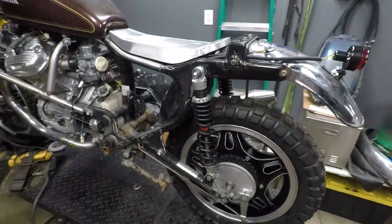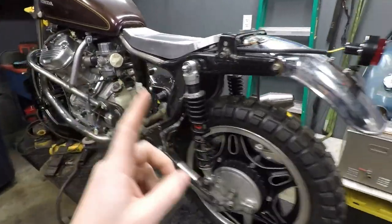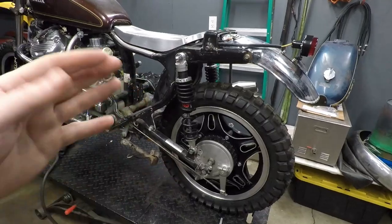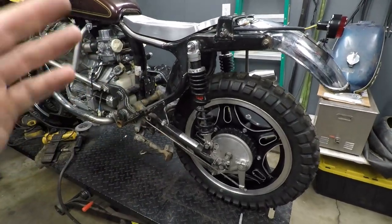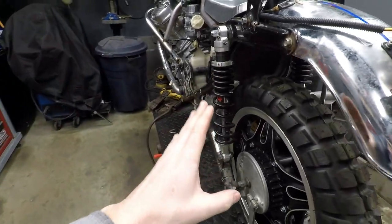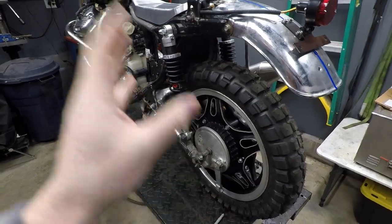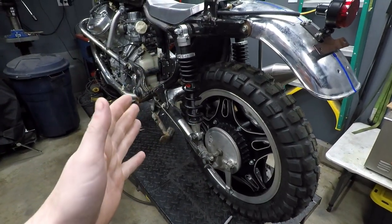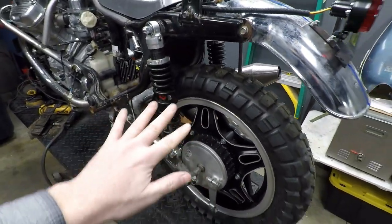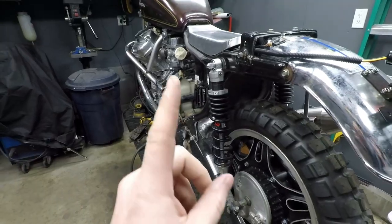As I get going designing these things kind of on the fly, I have some things to consider — trail-side repairs, because breakdowns and repairs will happen. One of my main focuses is the shock. If you have a flat tire and need to remove the wheel, in some instances it might be easier to undo the shock and lower the swing arm to give yourself more room to remove that wheel. So that's one thing to keep in mind.